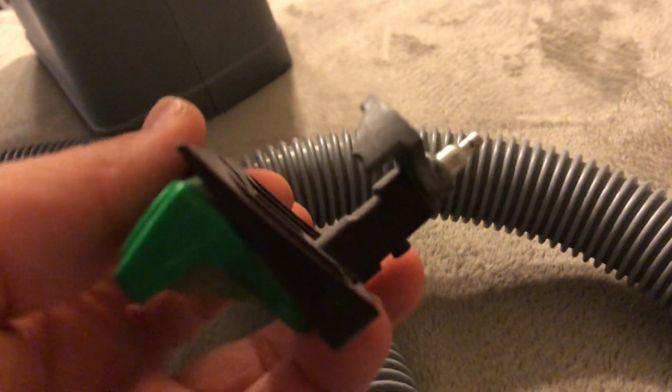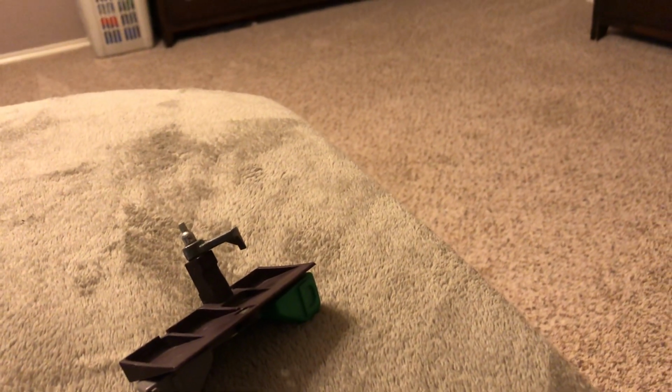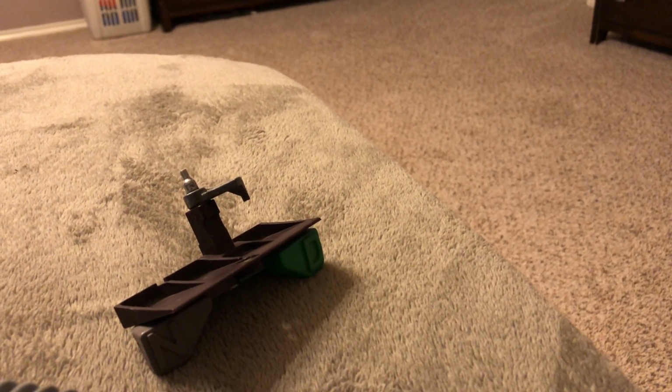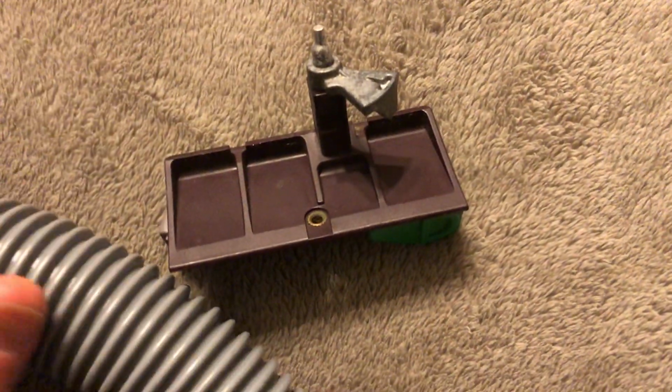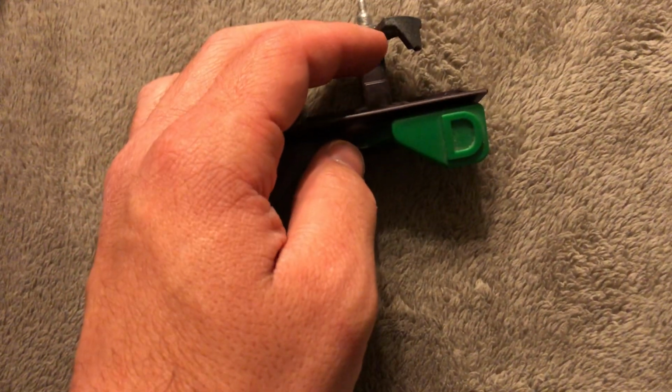I am trying to do a modification to this so I can get this to fit securely in its place, because for now it does work, but this little piece here likes to slide off and it doesn't hold the cam gear off all the way. When you're in neutral, sometimes you get that awful sound when the transmission will start ratcheting, moving forward and back. Partly that is because this switch plate has worked itself outwards over time and it doesn't hold it entirely into neutral. It'll still think it's going into drive. So I'm going to have to find a way to fix this.